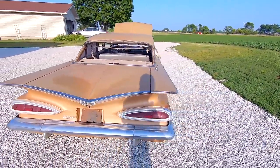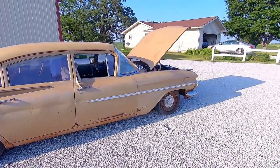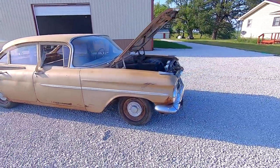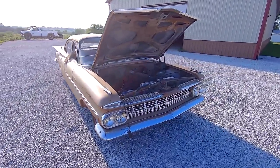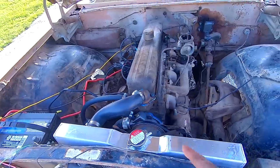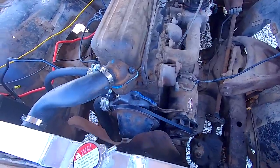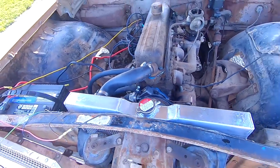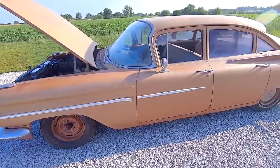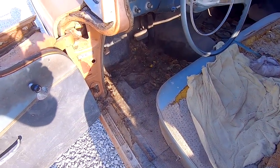This car is awesome. I put three of the four hubcaps on — that one was missing when I got it, so I figured let's leave it that way. The plan with this car is it's been sitting for 20 years in Kansas. I've driven it around the farm a little bit and just got the title a couple of weeks ago. I'm going to take this to my buddy Dave Marshall's — there's a car show out by them tomorrow. Brand new radiator, thermostat — I know people have debates on silicone, but it is just a thin coat and it did seal up nice, better than the paper gasket that came with it. Runs real good, drives real good. Brakes are all brand new front and back. I'm curious to see what people say about it in a car show with restored cars.